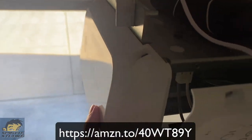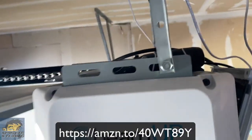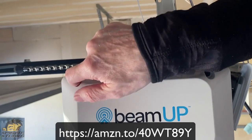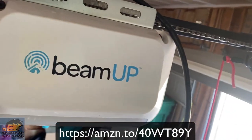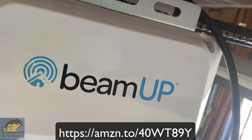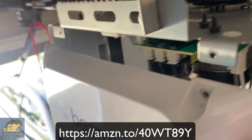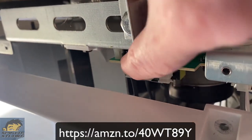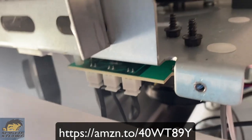Now go to the left side — there'll be two screws again to take this whole bottom part off on each side. There's one there and one on the other side. If we swing the camera around to the far side, same two screws again. Once you take these off, have your hand underneath because this top part will drop down and come off. Once you're taking the cover off you'll notice on the left side there are three clips — those are the three LED lights on the bottom — and you'll need to disconnect those next.